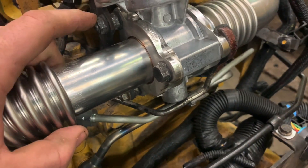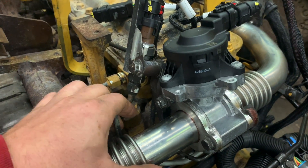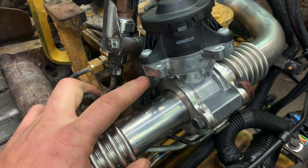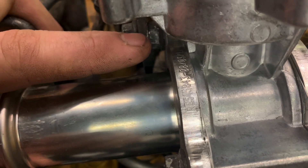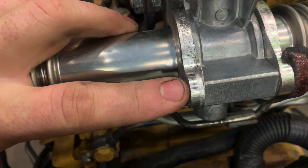You've got these two nuts to pull off. You have your pressure sensor here, exhaust pressure sensor here. The two nuts — that bracket comes off, then you'll be able to pull behind there. There's actually a stud that that nut is attached to — it's a bolt with a stud on the end of it for those two. You have just standard bolts here.